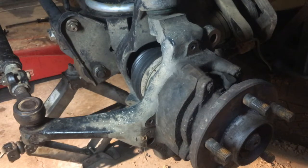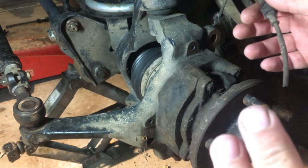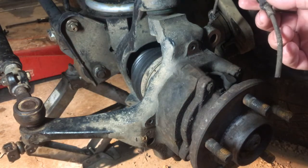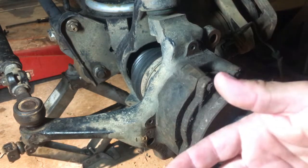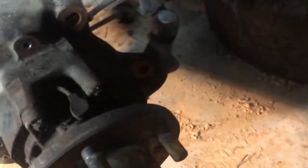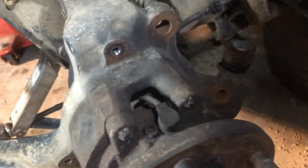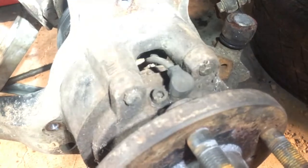What we've got here is a sensor from a second-hand differential front axle assembly and not real sure if these tone wheels or wheel speed sensors are any good. To get them out, it's easier to just cut the wire and drag it through. If you need to replace one, that's what you're better off doing because there's not enough room in that gap to pull it through from either end. If it's got the connector on it, it won't come through — you'll end up breaking it.